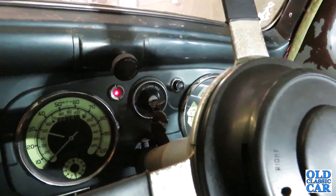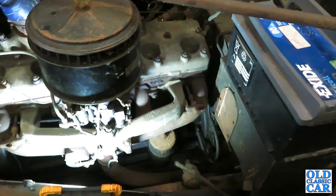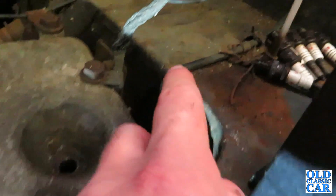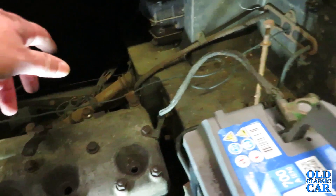Showing just over 30 on a slow turnover, which I think is pretty good. So that's ticked off the list - really good. It's showing oil pressure. Here's the take-off on the side of the block. It's got quite a long route to come up - it comes up here, round here, through the bulkhead and up to the gauge. So considering the oil is fairly old and has some body to it but is old, that's not too bad at all.